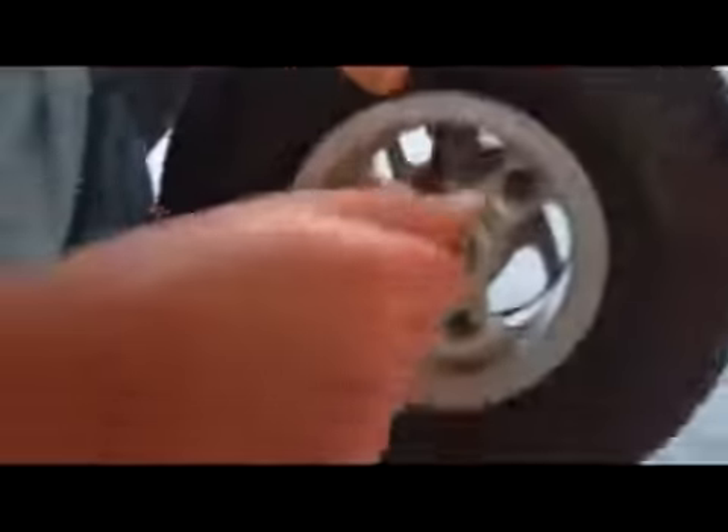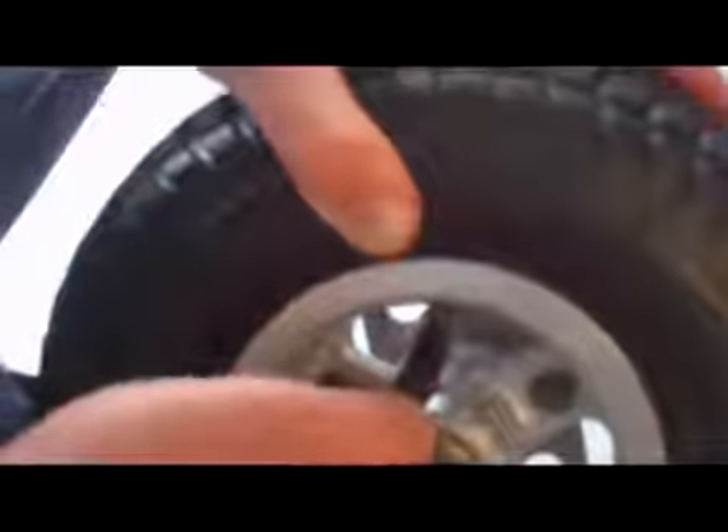You get a free tool kit, and a lot of people don't know what this is — it's your valve extender. This is so you don't have to take off the front or back tire. You literally go in here, screw it onto the stem, and this end will go into the tire pump. You screw this on there — it takes about 20 turns, very nice and tight until you can't turn it anymore. Then that end goes in your tire pump, keeping you from taking off your tire the whole time.